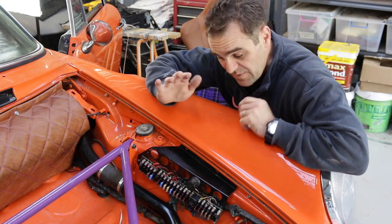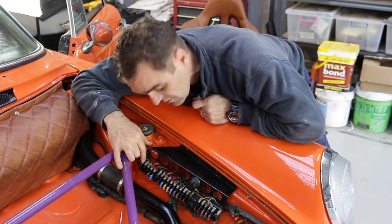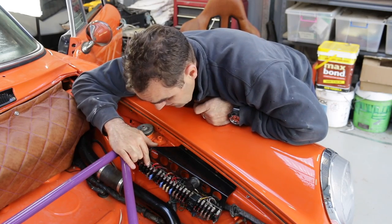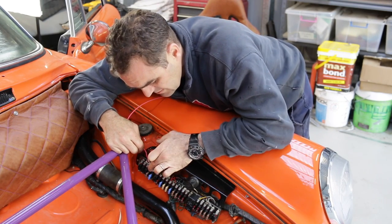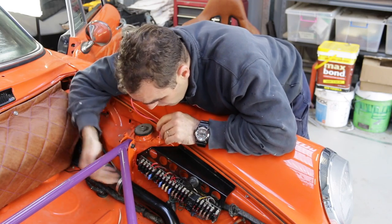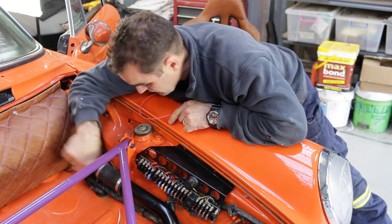To run my constant power, in the Classic Retrofit fuse box there are actually three fuses here that aren't used. I'm going to use one of these fuses — I'm going to jump the power from the next terminal over to this fuse here, this next fuse, and then run my new wire with a 15-amp fuse on it that I'll put in, through to the stereo.